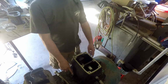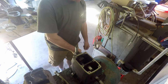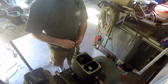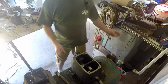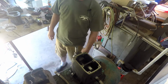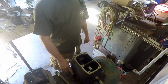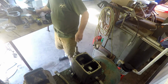I made some thick washers yesterday on the lathe just because these slots that hold this compressor down are kind of wide, and you know thin washers will kind of flip up. It had these small 3/8 bolts holding this down, and I didn't care for it because the holes are big enough for 7/16 bolts, so I went ahead and put 7/16 bolts and those big thick washers on the bottom where that slot is, flat washer on top, and then a lock nut. I didn't buy none of this stuff. This is some stuff we had left over from bumpers and stuff at work. Just some scrap bolts, and they're brand new hardware from truck accessories and stuff. So I kind of save that stuff up for sometimes using it.